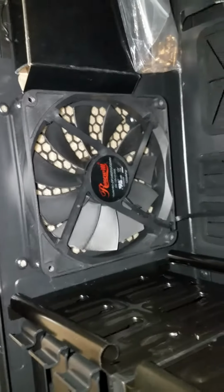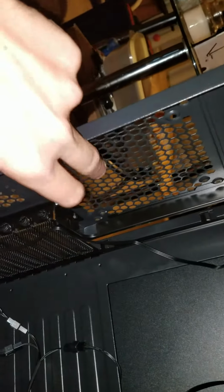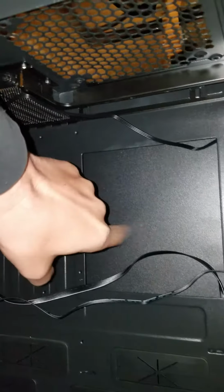Like I said, this case started life with a fan up here on the back of the case as an exhaust. As I mentioned previously, my H60 cooler fan and radiator will mount here as an intake. So I'm taking cool air from the outside, blowing it through the radiator, thereby cooling the air and water that will eventually run back to my CPU. That will be about here-ish when the motherboard gets here. Okay, sorry about the finger. I'm just giving you all the finger today.